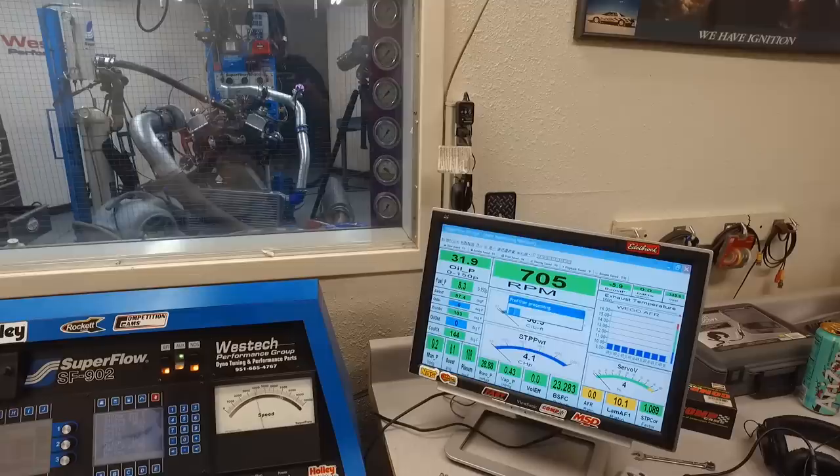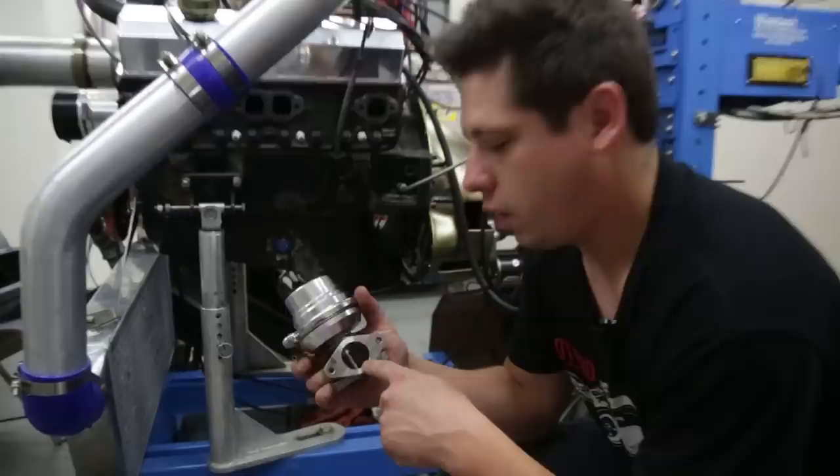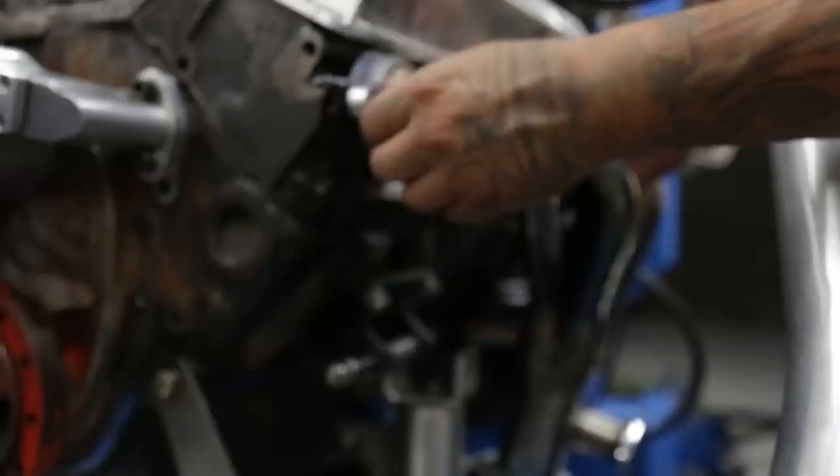The turbo is a very large turbo and it's a super functional setup — it just can't get the exhaust out quick enough. Today we took off the driver's side header and we're going to add an extra wastegate onto it to see if we can actually meter the boost properly. We're going to weld this on and see if it fixes the problem.